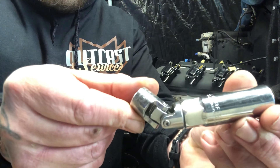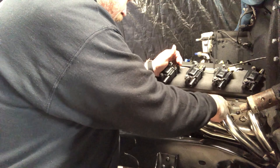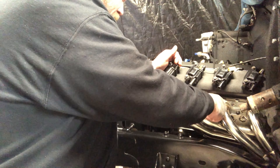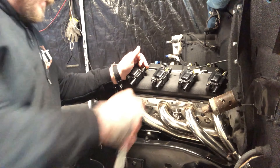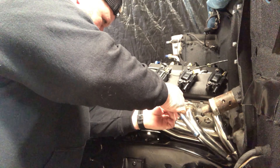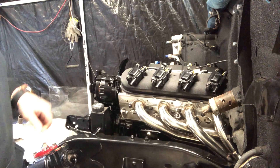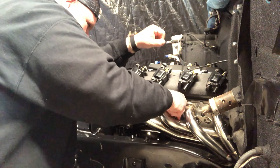You'll know if it's going in right, especially with brand new heads — they won't fight you at all. Get it all the way in there, go to hand tight, and then using the socket wrench you really only need to go about a half to two-thirds of a turn from hand tight and that's going to seat it. If you watch the wrench and go — boom — that's all you need, maybe a third of a turn and it's tight. We're not going to force it. On the more difficult ones with headers in the way, since I can't get my socket in there, I might have to pull those headers off and do the spark plugs, but I should get used to doing it with the headers on.